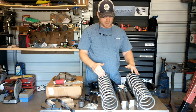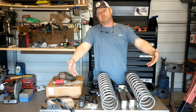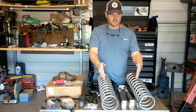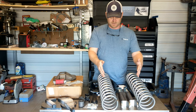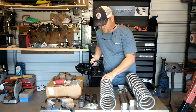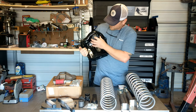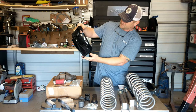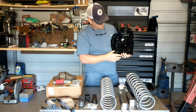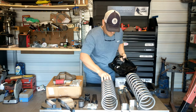We're going to convert this '91 Sonoma to a coil spring front end with a Dana 30. I could have put the Dana 30 on the table but it's behind the camera. I've got four-inch lift coils for a '94 Jeep Grand Cherokee, and then these — these are actual Ford Ranger upper spring mounts for the coil spring on the frame. When I mount this, this will be the passenger side because of the shock and the Dana 30, so I'm hoping this is what's going to make the conversion a little easier.